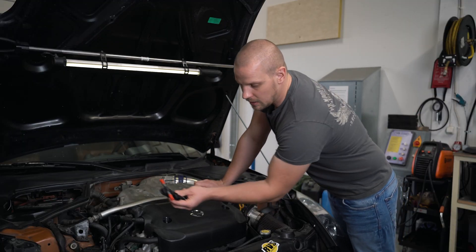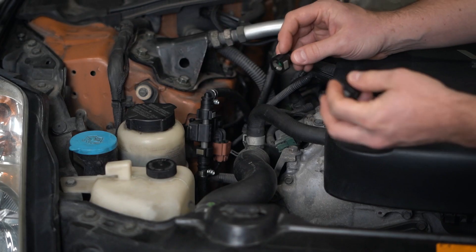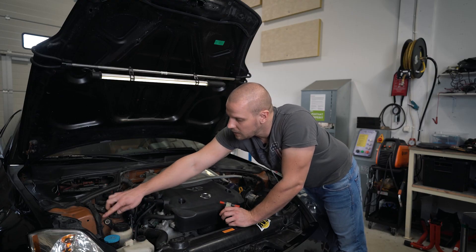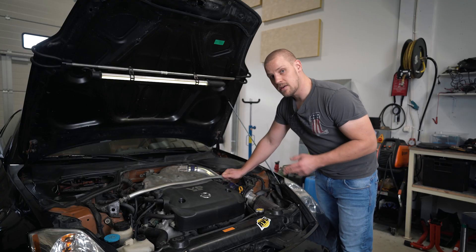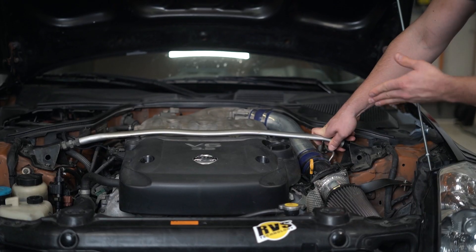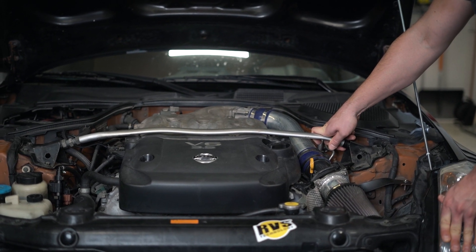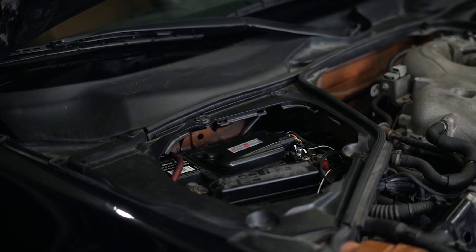For the ethanol sensor, it's located in this installation right here with two of the provided quick connectors and hose clamps. The wiring goes right here to the battery box. Additionally, with the eFlex Pro kit, you have the option of two external analog sensor wires that can be connected to different components in the vehicle. In this build, we have a mass airflow sensor and an external wideband O2 sensor installed, and these are wired and connected to the eFlex Pro control unit.